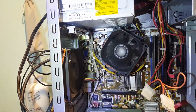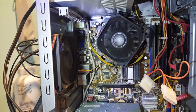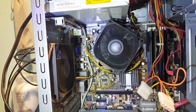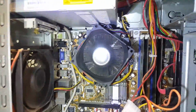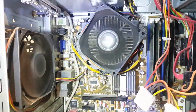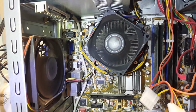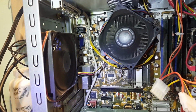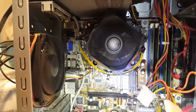But something else about this board that makes it special is you can actually modify the microcode for the BIOS and make this thing take a Xeon. Now, I'm not going to put a Xeon in this one because it's not my computer to be playing around with. But you can actually buy a Xeon chip that's already been cut out, the notches in it, or else you can do a hack to your CPU socket and cut out the notches there so that the Xeon will fit. I think it's the 5450 Xeon. I can't remember the number right offhand, but you could make that fit in here, and that would be the equivalent of the Q9650, which is pretty much about the top end of the line CPU that you're going to get going into this computer.